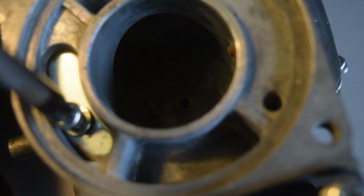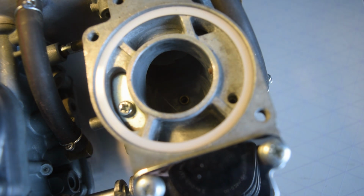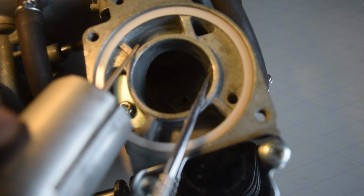Got the top end of the carburetor, I thought I might as well check the air jets to check that I've got them the right way round. Remembering that the large jet, the 120, should be more outboard and the smaller jet, the 60, should be in the more inboard hole. They were all correct, but it's best to be safe.